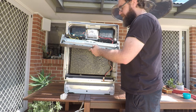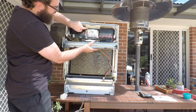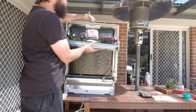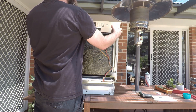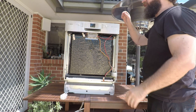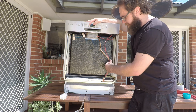You can also get further down to where the actual door sensor is. This is the actual sensor up here, so just make sure that that's firmly plugged in as well. It basically works on having a magnet at the top of the door so it can tell when it's closed or not. Give that a good thorough check and make sure your wiring is hooked up properly and none of the cables are frayed or anything.